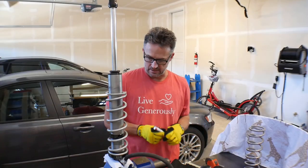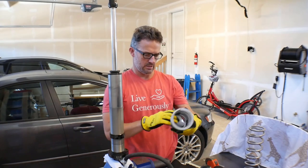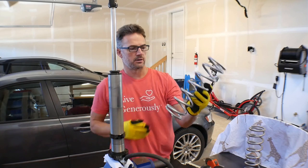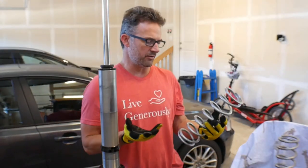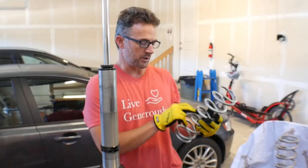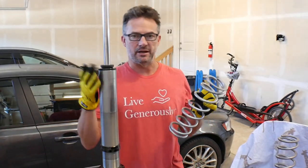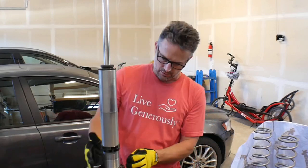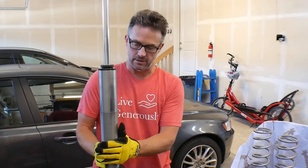I set that aside and then take off my top spring, which is my smaller one — the 150. The springs you have should have their model number on the side. These are Eibach springs. This one is marked '1200-300-150,' which means 1200 is the 12-inch length, 300 means it's three inches in diameter, which matches the two-and-a-half-inch body shock, and 150 is the 150-pound rate.